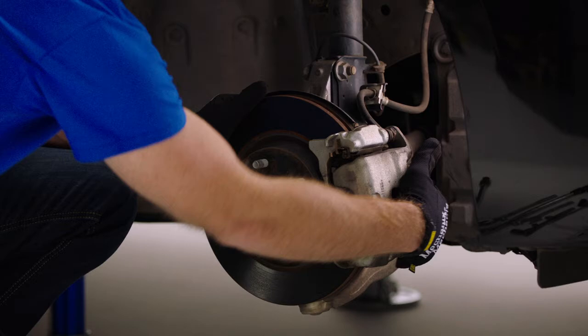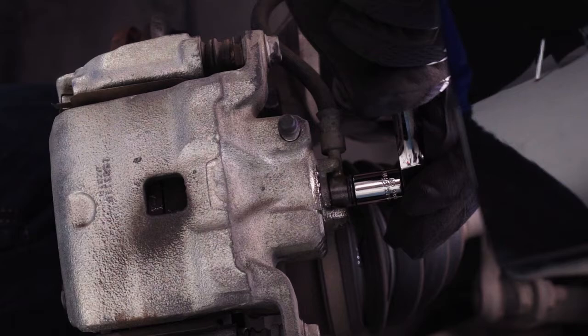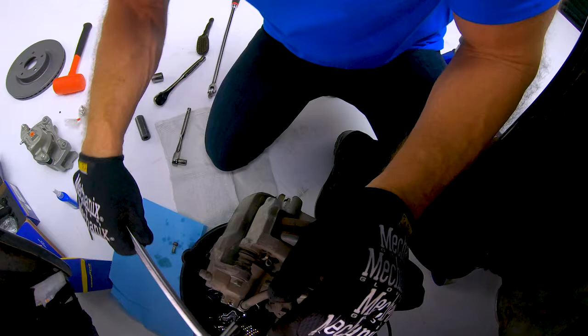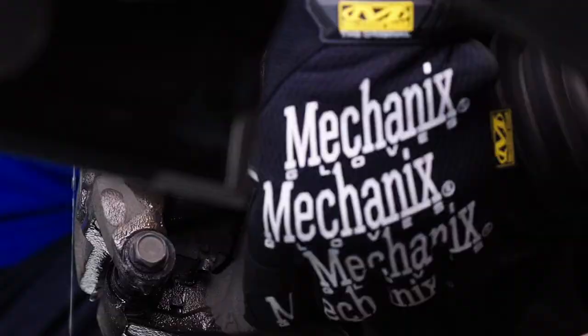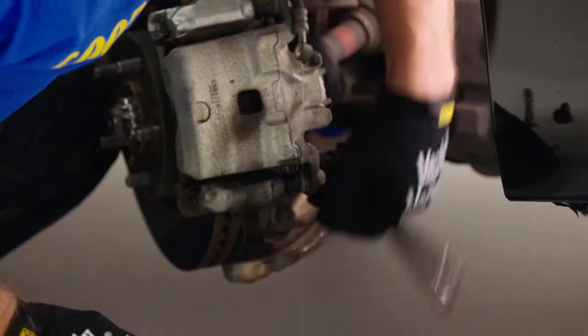Let's turn the steering wheel out to expose the brake assembly, which will give us quick access to the brake caliper and rotor. Step three. Now we're ready to begin. In order to remove the old brake pads and rotors, we must remove the caliper and bracket assembly from the knuckle. First, we're going to loosen the banjo bolt with our socket wrench, which allows the brake fluid to flow into the catch pan. Next, we remove the caliper bracket bolts that connect the caliper bracket to the knuckle by first removing the lower bolt and then the upper bolt. This is where you will need your breaker bar to loosen those bolts. The breaker bar gives you that little extra leverage you need to remove each bolt. Then use your ratchet to remove the bolts entirely.